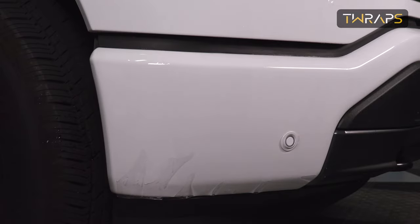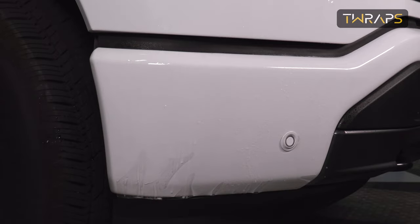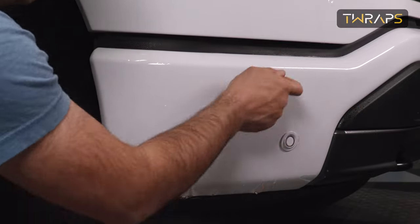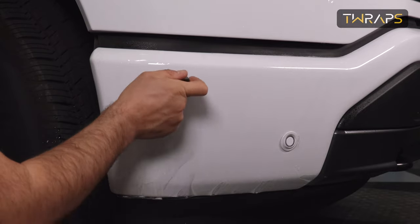Okay, now the top looks fine. Before I seal the bottom though, I recommend that you spray the film again. And squeegee out again, this time apply more pressure so that if you have any bubbles left, they'll go out from the bottom.